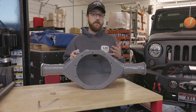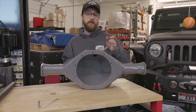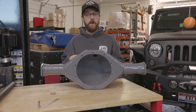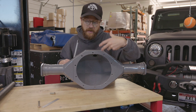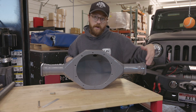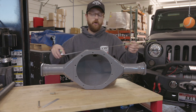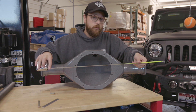The last dimension you can take — on some but not all rear ends — is housing flange to center of pinion line. This will probably require a couple of buddies and some straight edges. If your differential is in, the pinion yoke sticks way out from the housing, so you'll need a straight edge on the housing flange and someone to hold your tape while you eyeball the center of the pinion line. This is the easiest one to mess up.